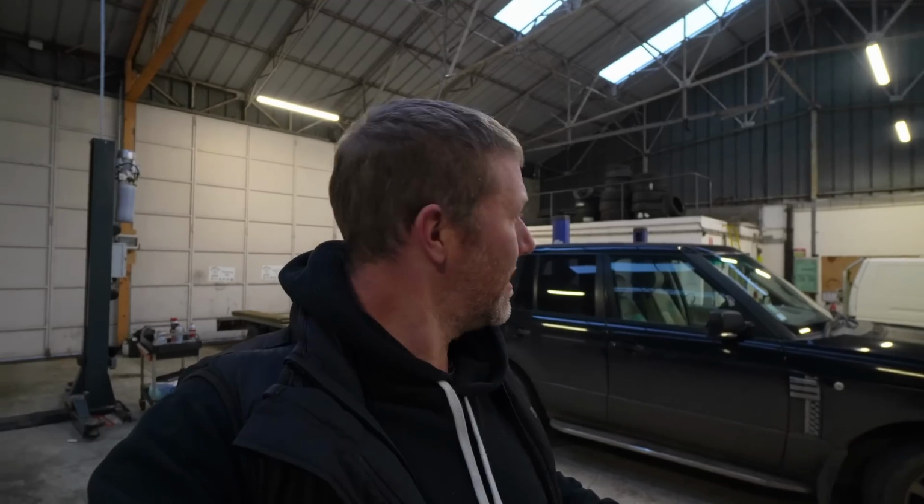So as annoying as it is not to be able to make progress, because I can stand in front of the heater, I'll just have to get to that tomorrow and really hope for the best. Hopefully the part arrives for this Range Rover, although according to the courier, it's in my postbox, which it's not and hasn't been. I can test the BMW in the morning because it only has problems starting like that when it's cold and the glow plugs come on. Previously I've changed all the glow plugs and changed the glow plug controller, so I could actually be leaking diesel through a leaky injector into it. We'll see. I've got to go and test everything, but it only happens when it's cold. I really can't afford to be without a car to run around in. So sadly, I've got to take time away from the multiple projects to be able to stay on the road, to be able to get to the workshop to do the projects.